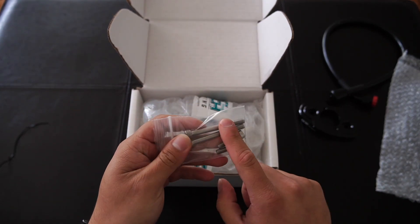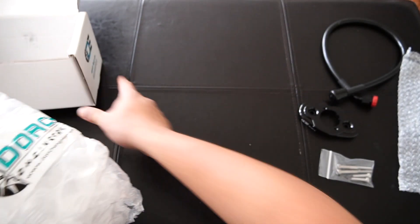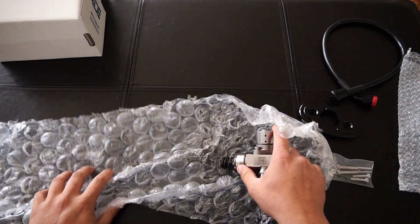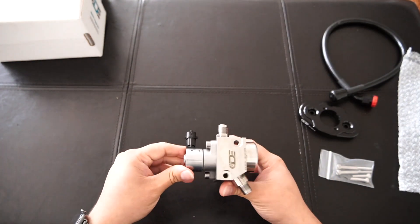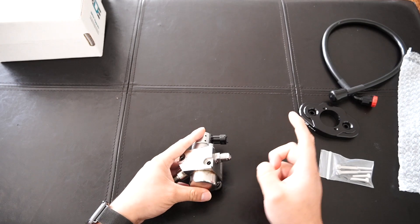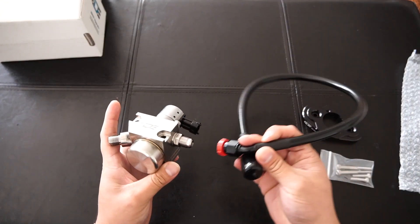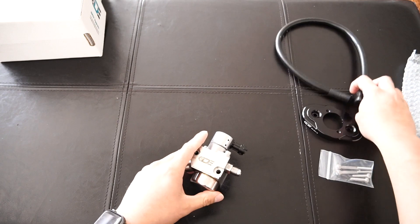I've already opened it because I was just looking at it when I first got it. This pump is a little bit different than the one previously offered. The design overall is almost the same, but one of the bigger differences is right here where the line connects. They've added an AN fitting, which makes sure that the connection is safer and actually connected properly, and also it's going to allow for that access on cylinder 5, which was a big deal.